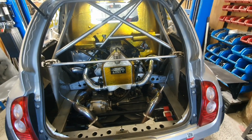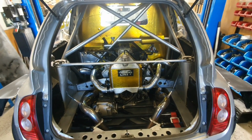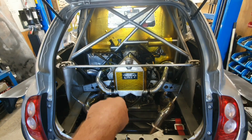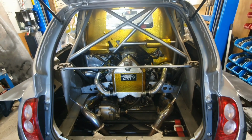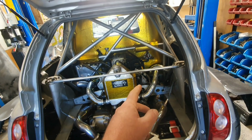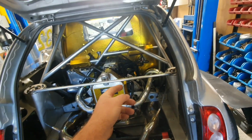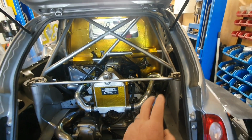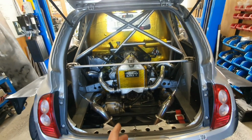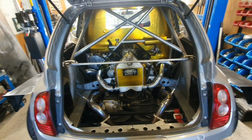In the video you'll see the second to last run or something. Did I leave it there? I walked over to the dyno and the number had gone down. What we did there was we advanced the spark timing, so the engine goes this way, so you would advance your timing this way a little bit, to make a little bit more power, and it went slightly less because there's less heat going into the exhaust, right? All the fiery, bangy, make it go fast things all happen inside the motor, and there's not much left coming out, so the turbos don't spool as hard, and it actually lost a tiny little bit of boost. So we could have chased that further, and brought the boost back up, and it would have probably made the 800 horsepower at the hubs that we sort of thought we might do with a slight tweak.